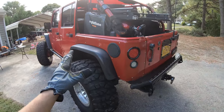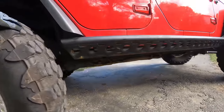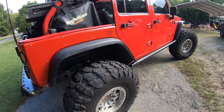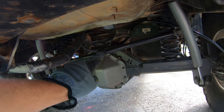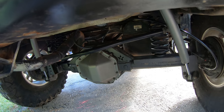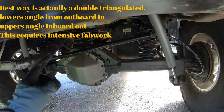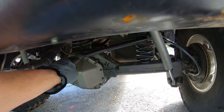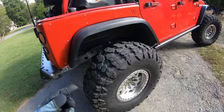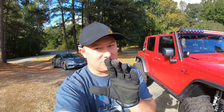It is impossible to build a bulletproof Jeep — you'll always have a weak link. Why not go with a four-link? The rear of the JK makes it extremely difficult. The gas tank along the passenger side makes it impossible to do a rear triangulated four-link without moving it. A triangulated four-link has both upper arms centered on the axle, triangulating out sideways to the frame. Because of that gas tank, we have two options: run a three-link right in the center of the diff up to the frame, or go with one of the other four-link long arm designs on the market.